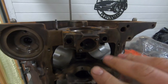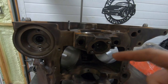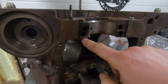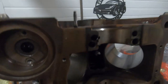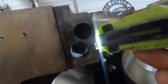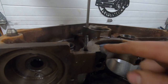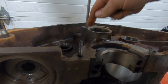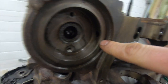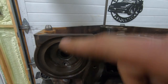This is your rear cap, and your oil pump bolts on here. The oil pressure is pumped from your pan through this passage into the block right here, and it goes into this passage. If we look in here — let me shine a light — there's actually a gallery plug in that passage up there. What that gallery plug does is it actually diverts the oil, instead of going straight up into the block to the cam tunnel, it diverts the oil over to this hole so the oil goes through the oil filter. Without that plug, you are getting unfiltered oil into the engine.